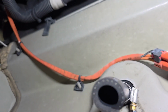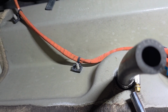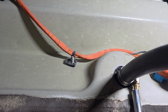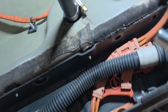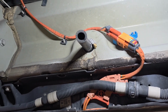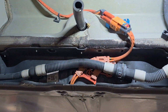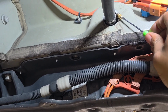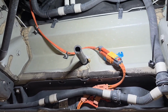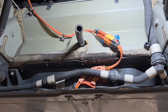So simply, this is what I did. I went and got a hose to protrude it out and slid it over the other hose, and I actually tightened it right here with a 10 millimeter, and that snugged it. And I'm not an engineer, you know what I'm saying? So you got Tesla that engineers rockets, and you can tell me that this is what you came up with for an AC drain that drains on high voltage wires. And look at that. That's your battery right behind this. And regardless of if it is flowing properly, it's still getting in a bad spot.